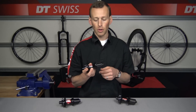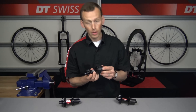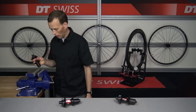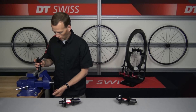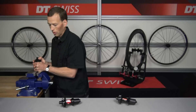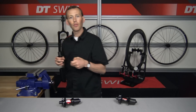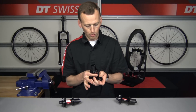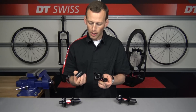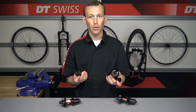I'll show you quickly how we can determine this if we don't know that it is a 370 thru axle hub. We're going to go over to our vise with our soft jaws because we don't want to mar up the hub end cap if you use the steel jaws. We have aluminum soft jaws in there — we're going to lock that drive side end cap into the vise and just quickly pull that hub off. That end cap is held on with an o-ring, so once you break that o-ring free it comes off very easily. Once that's off, you can spin the hub and slightly pull on the free hub body and that will release it. Very simple hub, pretty much tool-free to get in to do service or convertibility.